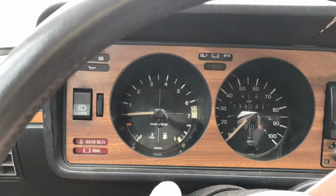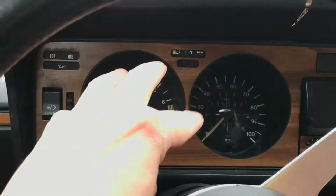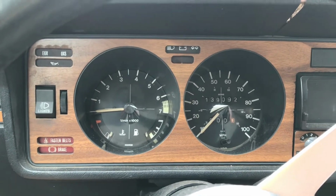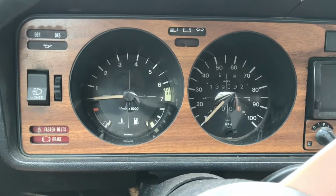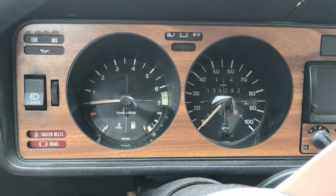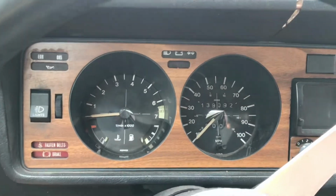Yeah, so after some more research, there is a voltage regulator, they call it, behind the dash. Basically, it steps down. It's a resistor, I would say. Maybe there's more to it, but it steadies the voltage to like 9 volts, and these gauges run off 9 instead of 12. Cripes, I'm guessing that might be bad. So we're going to take that dash out and diagnose it.